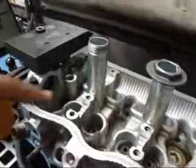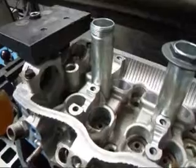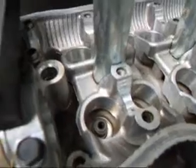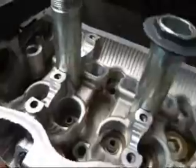What we're going to be doing is pulling a vacuum on this and then applying a sealer so that we can seal off the leak. The idea is to let the vacuum suck in or draw in the sealant and let it set up and harden. We're going to be using a heavy duty vacuum pump, though this could also be done with a small handheld unit.